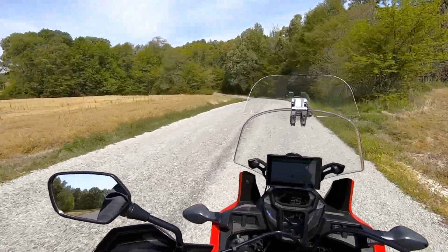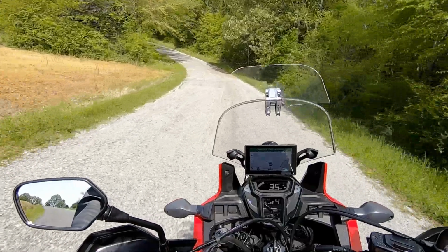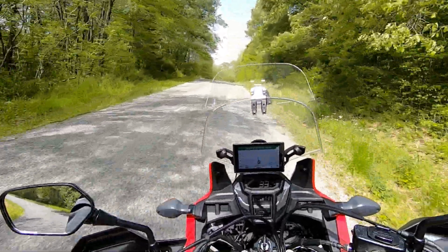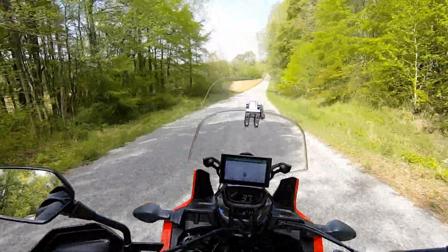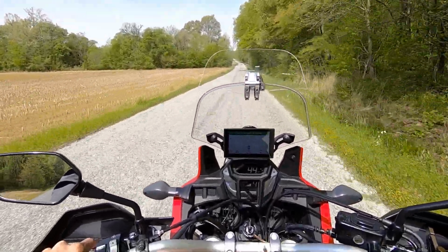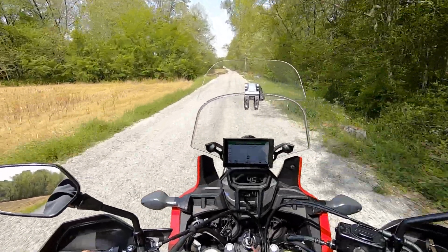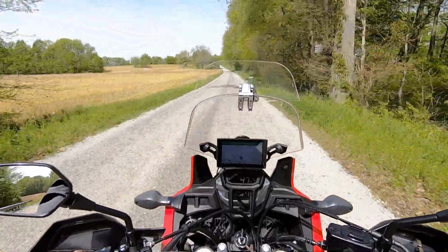So I guess when it went flat, it messed the tube up really bad. Because, you know, they're not tubeless wheels. So when it goes flat, it doesn't have that bead to hold the bead up on the wheel. So it just falls in the center and messes the tube all up.